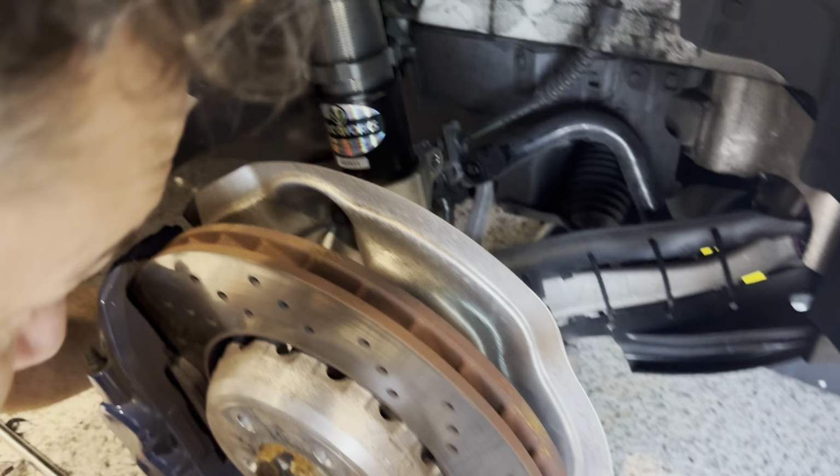Okay, now it's not going to come out straight away because there's going to be tension on it. We're going to get the little jack and jack up underneath the whole hub assembly, and it'll put it in line, and we'll be able to take it out nice and easy then. I've got a lift block, just a rubber pad on top so we don't damage anything. Don't have to, but it's kind of handy to use. And we'll drop it down